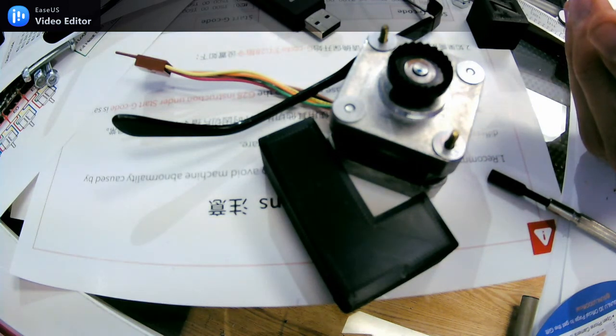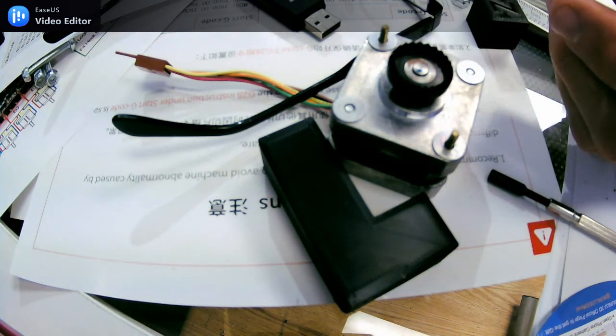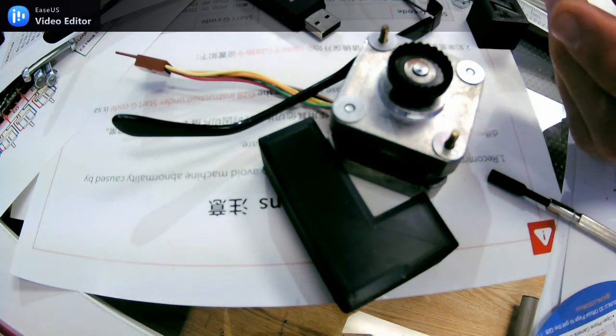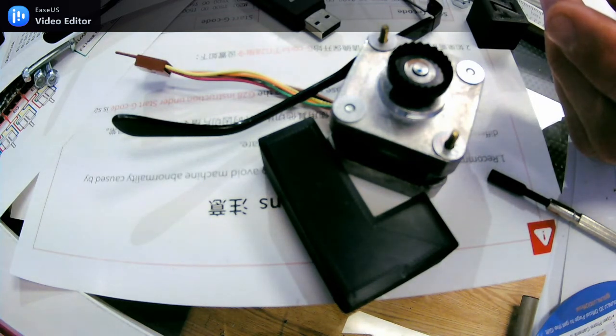I looked around the internet and found a couple of links to drivers. It looks like 3D Studios had addressed this issue, and they indicated that most of Creality's boards used an FT232R chip, although some used a CH340, which are essentially USB to serial RS-232 chips.